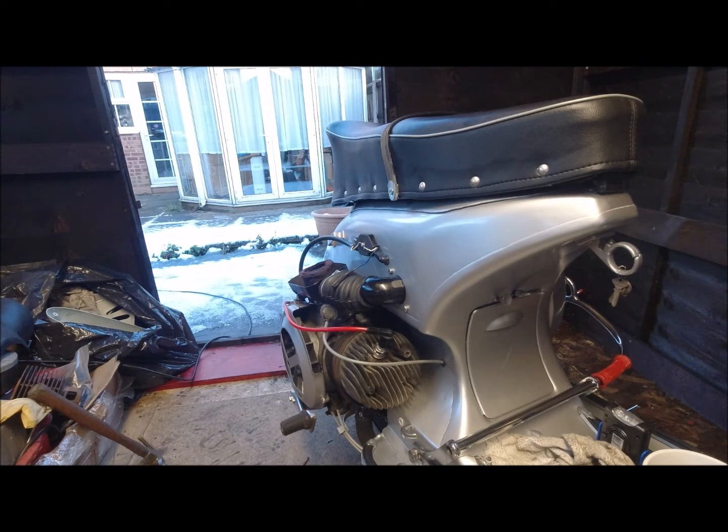They run to 5% on them, but when you're thinking about a P200 nowadays, it's running on 2%, all because the bearings are not phosphor bronze bushes, they're actual needle rollers. The crankshafts have been improved, so you need less lubrication. So these old beasties, I think they erred on the side of caution anyway.